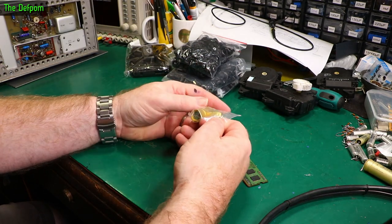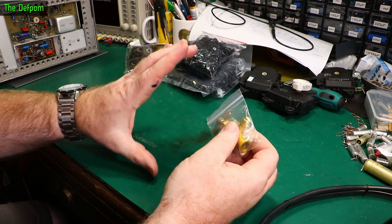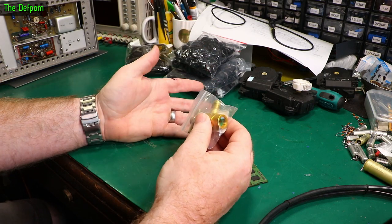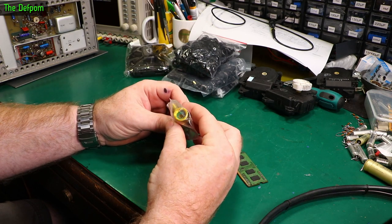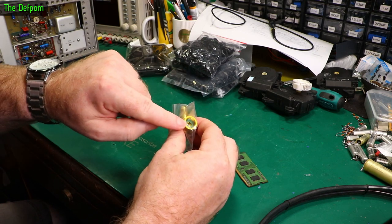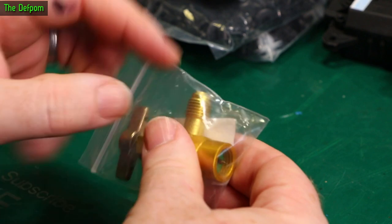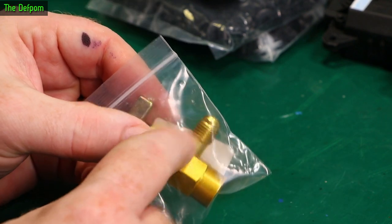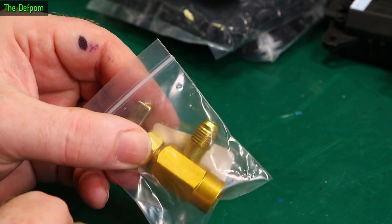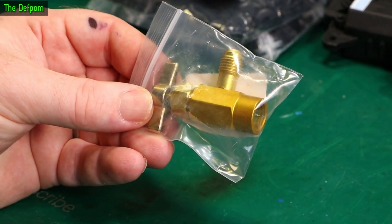And this goes back to my air conditioning stuff on my car — the little cans of refrigerant. So these are R134A refrigerant cans which have a threaded top on them, and you basically screw it onto the can. It's got a little needle in there which pierces the can when you screw it down. And you have the hose coming off your gauge set to top up your air conditioning. Not particularly exciting, but you may need one.